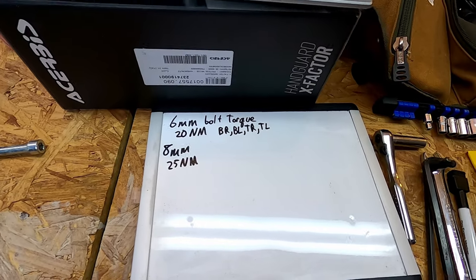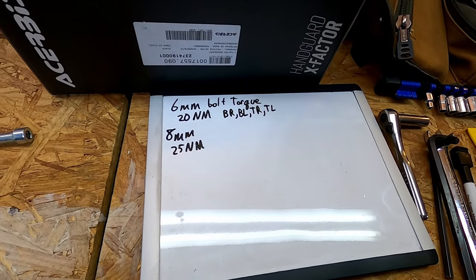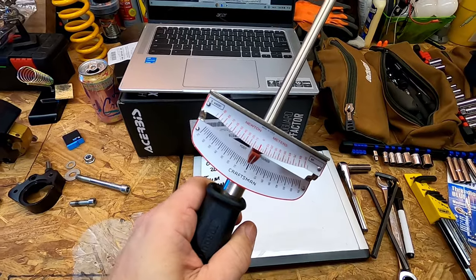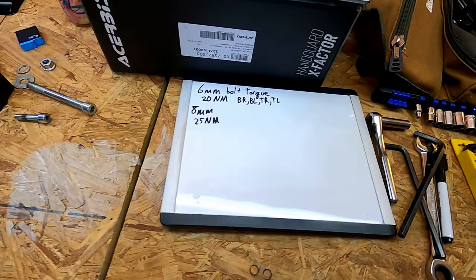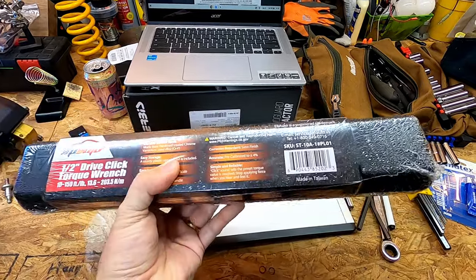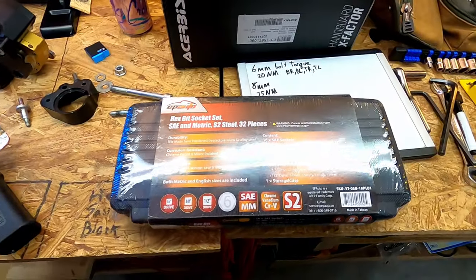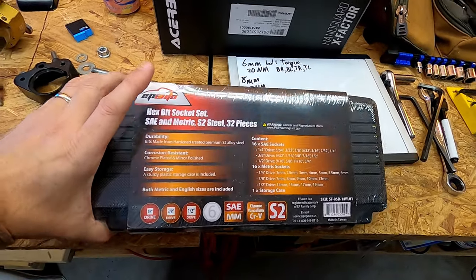So we're a day or two later than when I was last filming my video. I've gotten the towels and protection on the bike. And I started to go through and look at the torques that I need to have the various 6 millimeter and 8 millimeter bolts be, and realized that while I do have the Allen wrenches for that, my torque wrench wasn't going to cut it. I don't have a way to attach my torque wrench to my Allen keys. So I ended up going out and buying a new torque wrench, just so I have both kinds. I haven't had one of these before, but this was pretty cheap on Amazon. And I bought an entire hex set that has all the metric and SAE Allen keys that I would need, but they can now go on a torque wrench so that I can torque things to the appropriate tension. So that was really important, and I am glad that I took the time to wait and do that rather than just half-ass it and try to tighten it with my hands.